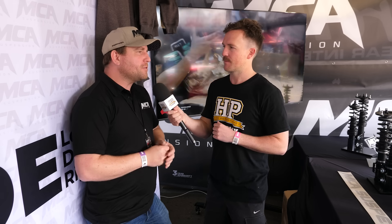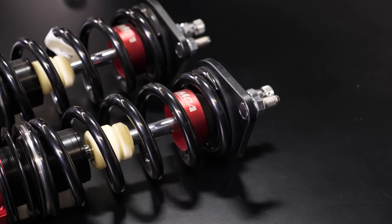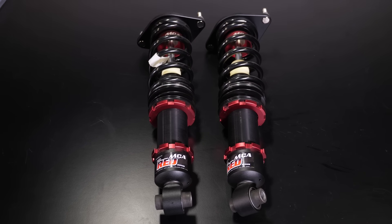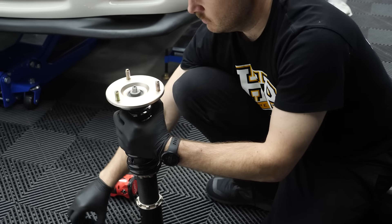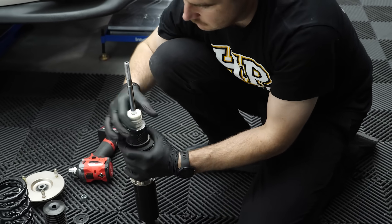It's quite common for people changing spring rates to need revalving if they get too far outside a window. I try to make the valving versatile so you can change the spring rate a decent amount without worrying about revalving — at least a few kilos of spring rate change before that's needed. Springs are easy and cheaper to change; any mechanically capable person can do it and we only charge around $50 a spring, whereas a revalve might be more like $350 a corner.